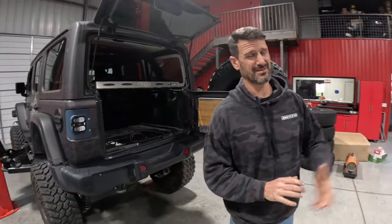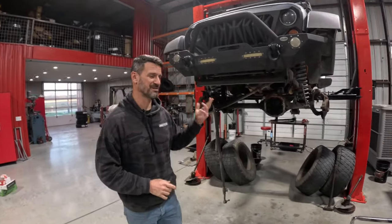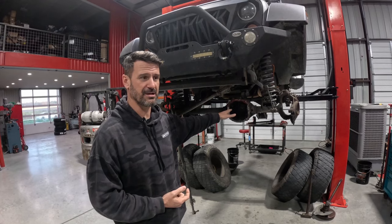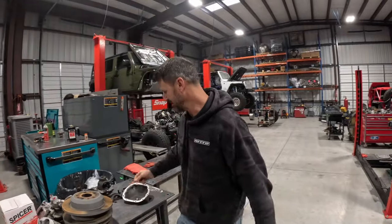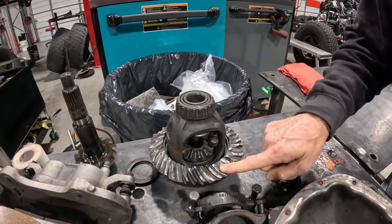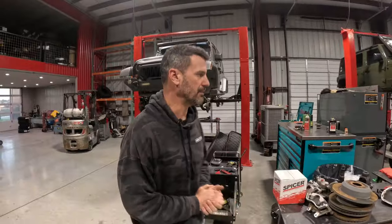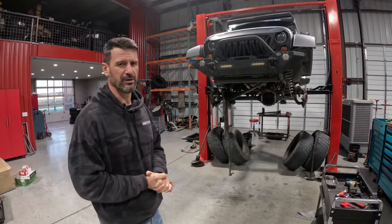Let's talk about oil and differential maintenance — it's important. This one's in just for a re-gear, but we may have to replace the entire axle housing because today we had the torch on the pinion and were beating it with a sledgehammer from behind. It's pretty much welded in because the oil was bone dry inside that diff. Carrier bearings and teeth don't normally do that, but they do when you don't put any oil in them. Jesse's knocking that one out — coming in tomorrow. We're talking about maybe replacing it with an aftermarket 44 axle, maybe like a UD 44 or something.